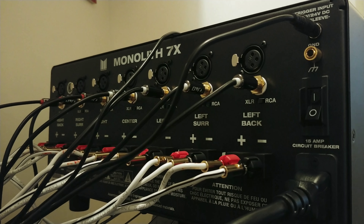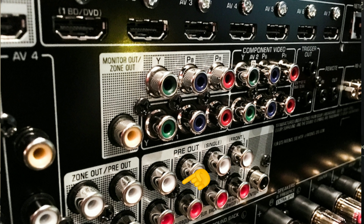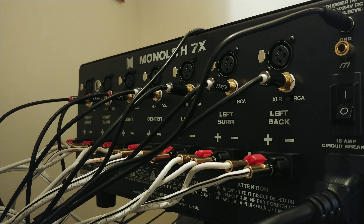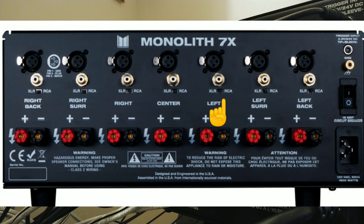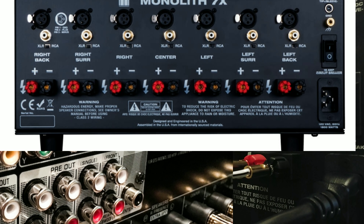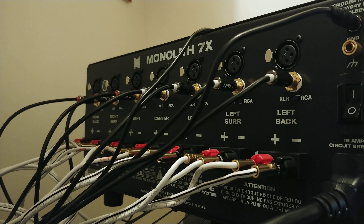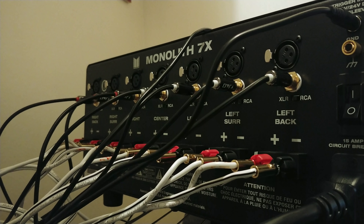In case that wasn't clear, here are some pictures. On the back panel of your AV receiver, find the output for front left and front right, circled on the screen. Once you've connected those RCAs to your receiver, find the corresponding RCA input on your amplifier. Do the same thing for all other speakers you'll be using — use the center channel output to find the center channel on the amplifier, use the receiver's surround outputs for your surrounds. If you're using height effects — Dolby Atmos, DTS:X, or Auro-3D — plug those into your front presence, height speakers, or wherever labeled.